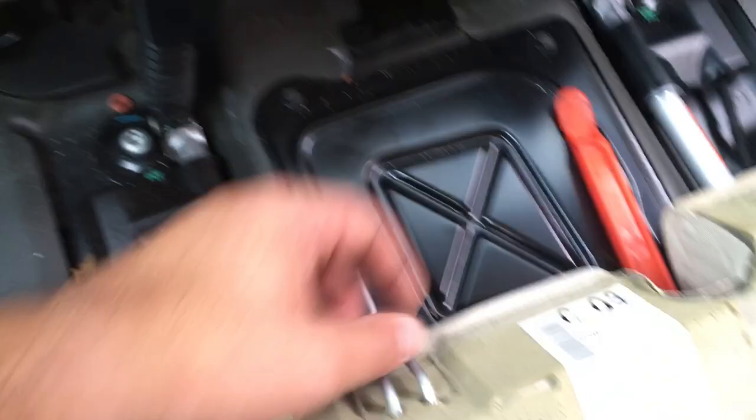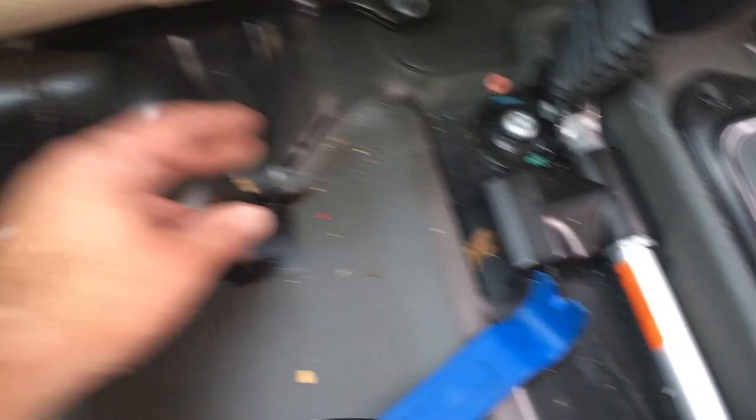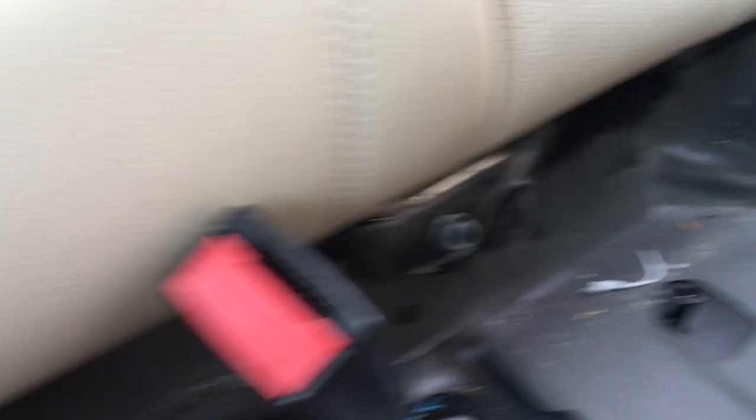In the middle here there's a metal loop tucked inside this latch - you've got to push the loop in and then up and over to get the whole thing out. The sides are just a plastic stud that clips onto a C-clip. Now that we've removed that, you can see there are bolts that hold the seat backs, and there's one on the side here as well that looks like a Torx.